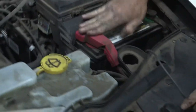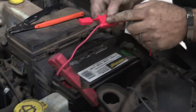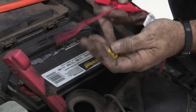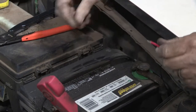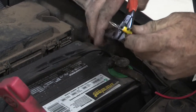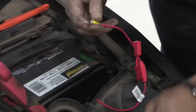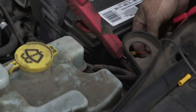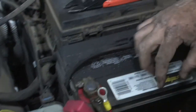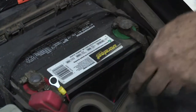Now we're ready to take the provided hardware and attach it to the positive side of the battery. The provided hardware is a red wire with an inline fuse, which we'll attach using a butt connector and an eyelet. We'll start by taking the sheath off and putting the eyelet on. To keep it looking professional, I'll come underneath and follow the existing wiring. We'll attach that right there. The other end of the wire goes to the wire we ran — we have a bit extra so I'll cut that off.